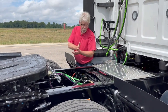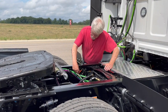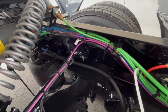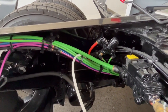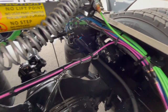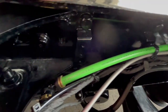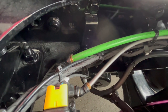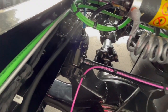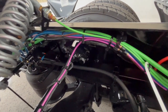Another interesting feature of this new Western Star design is the clipping and routing of the cables. What they've done is create separate channels all through the frame for the fuel lines, the airlines, and the electrical lines. The idea is to prevent chafing from happening between the cables. Any technician or maintenance person will tell you that one of the biggest headaches fleets have is chafed and rubbed wires. So Daimler and Western Star have gone a long way to keeping these cables tightly bundled and channeled within their own channels.